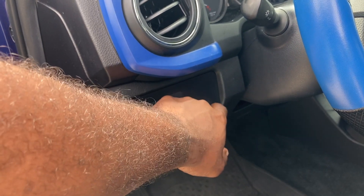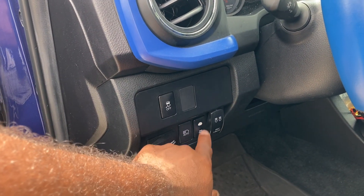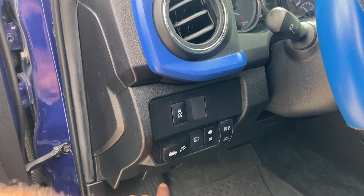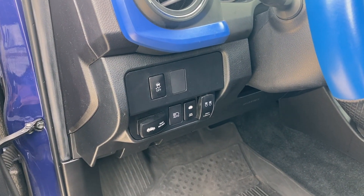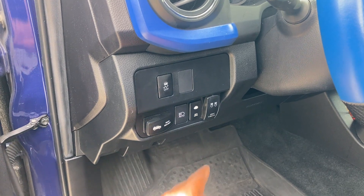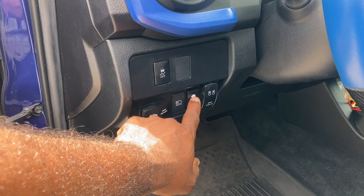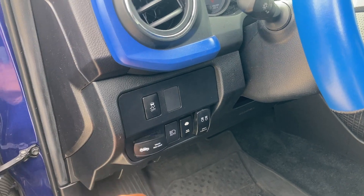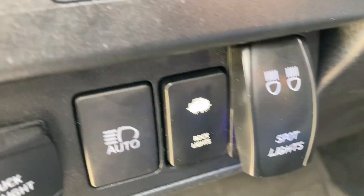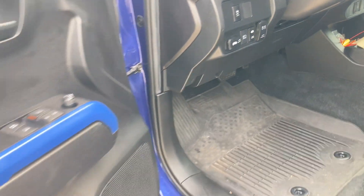So you have a ground — I just grounded a black wire to a bolt to the body of the truck. The yellow wire would be where this stays lit the whole time. If you wanted to hook it up, you'd find a wire like a tire sensor right here that works off the ignition, so basically when the ignition's on both top and bottom will be blue, and when it's off it goes out. I just wanted to know if I had them on because it would show blue. These switches are the same way — only blue when it's on.